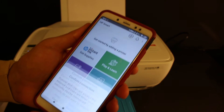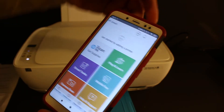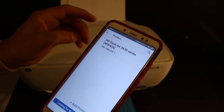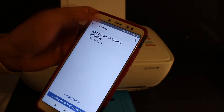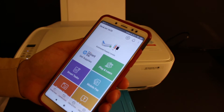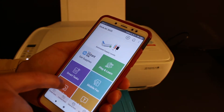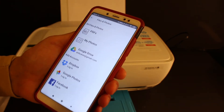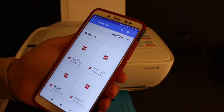Once it is connected, open the HP Smart app. We have to add the printer, so click on the plus button on the top and you will see the HP DeskJet 3630 series printer is available. Click it and it will show up in the app. Now we will go and do the wireless printing — click on the print document section and select a PDF if you want to print.